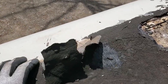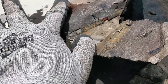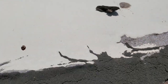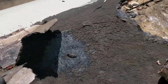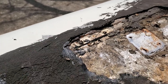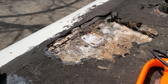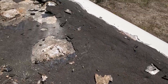Right, so as we get into a little more sun today, it's definitely becoming more pliable. But you can see what we're dealing with here in the back. There's like regular caulk or some kind of sealant, and there was something weird like silver on top of that, some sort of a silver roof coating. And then on top of that, they came back through with this stuff. But you can see here how the aluminum roof is underneath the back wall. It's the same in the front where the roof actually runs under the wall. So obviously taking out that aluminum is going to be quite an ordeal. So we're still hopeful that we can get this roof to the point where we'll be able to salvage it with a rubber roof coating.